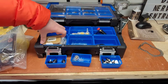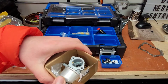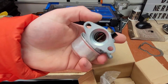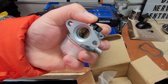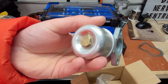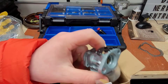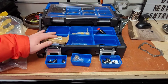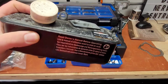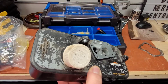The next part is going to be carburetor and carburetor parts. It kind of depends on what you work on a lot. If you work on a lot of Briggs & Stratton quantum engines, you're going to want to have a few of these carburetors, because eventually you're going to have some bad ones that you run across, and it's just cheaper to replace it than to have to rebuild it and tune it and everything. So I would keep one or two of these in stock. I would also keep in stock the Briggs & Stratton plastic carburetors that go with this gas tank. They're pretty cheap and they're good to have because these gas tanks are really expensive — like a hundred dollars if you want a new good quality one.